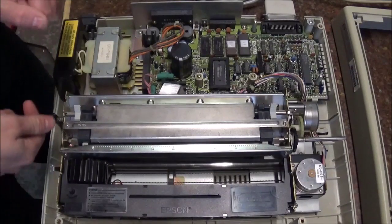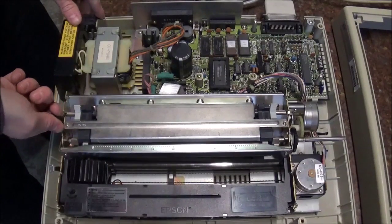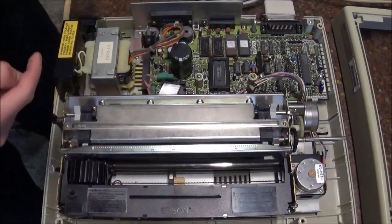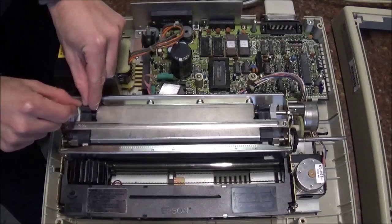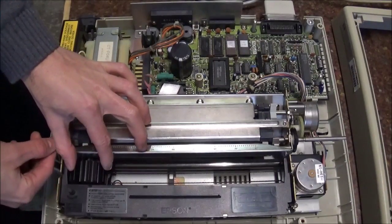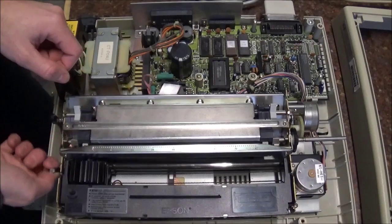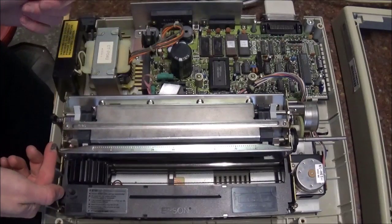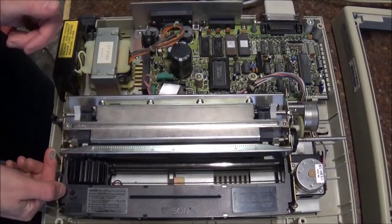As one would expect with a printer of this age, there are many setups that are reminiscent of typewriters. For instance, this latch here is a paper release that you can insert a fresh piece of paper and then lock it into place. There are also tab settings here, and you can shift to adjust the size of the paper. This small lever here moves the print head slightly back and forth on an eccentric shaft, bringing it closer and further away from the paper — I'm assuming that would be some sort of print intensity setting. Having it very close would mean very high impact to the paper; having it farther away would lessen that impact.